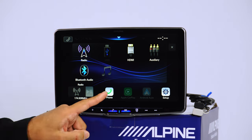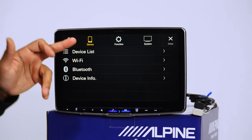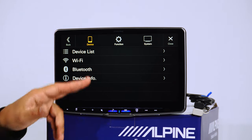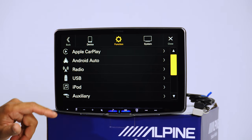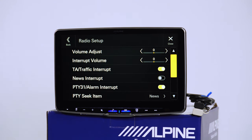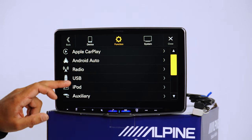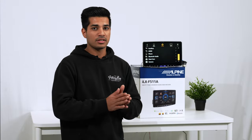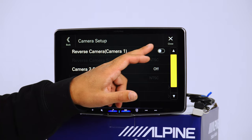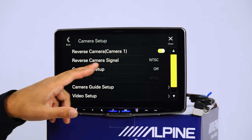There's a phone button and a setup page on the home screen. In Setup, under Device, you'll find your Bluetooth and Wi-Fi device list to pair your phone. Under Function, there are Apple CarPlay settings — microphone level, voice recognition, media, calls, volume — and the same for Android Auto. Radio, USB, iPod, and auxiliary settings are there too. Under Dash Camera settings you can configure your dashcam input, and under Camera settings you can turn the camera on — important if your camera isn't working after install — and adjust signal settings.